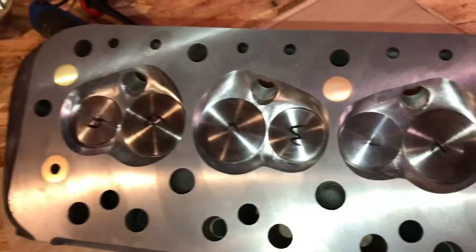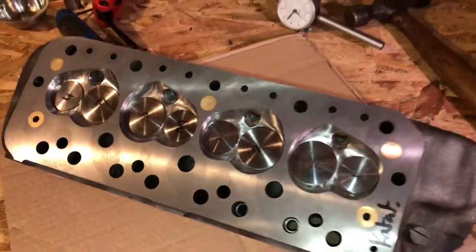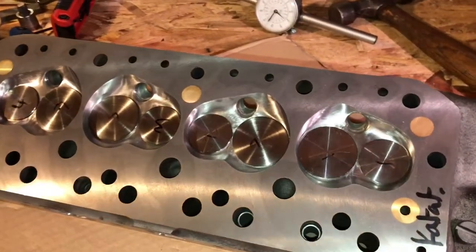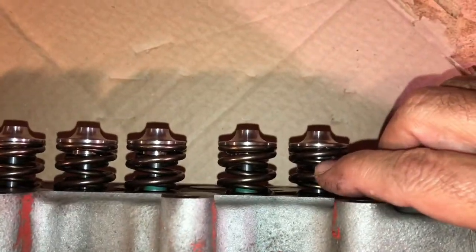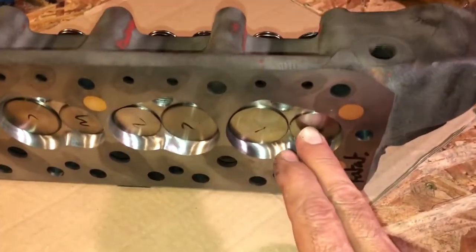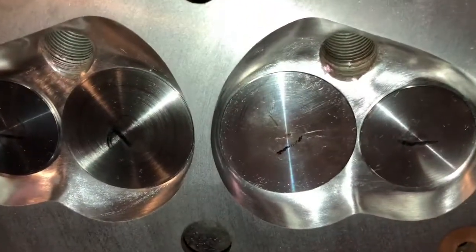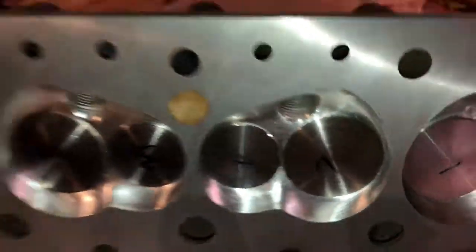The other item we've been waiting a long time for, and it has been worth it. This is one of the MED Series 6 heads, so-called because they use 6 millimeter valves — narrower, smaller valve stems, smaller guides, less interference in the flow of the ports, and just enormous, almost one-and-a-half inch intake valves. I think they're 1.496.